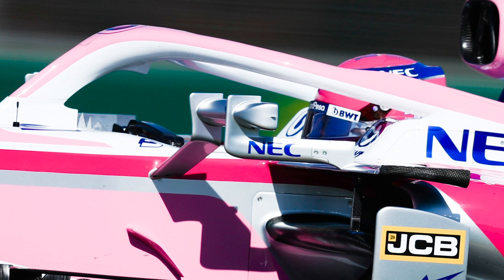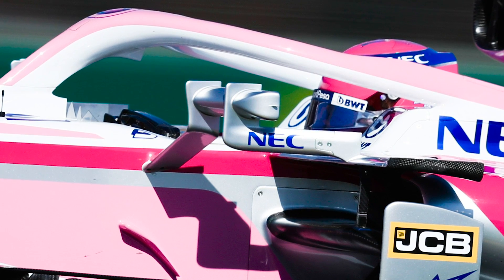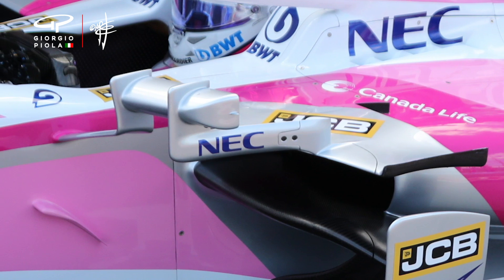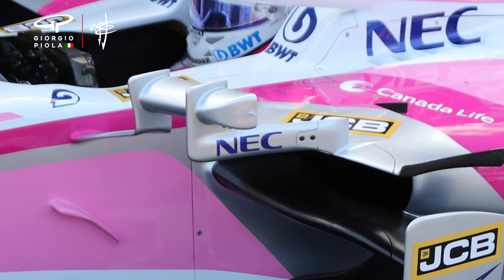They're collecting it up and cleaning it up with this one, then being able to clean up the underside of this one, then sending it on its way down the side of the car. There have been a few changes to the bargeboard. The mirror is also very different — it was a very conventional twin-mounted mirror before, but now they've come up with these very elaborate mountings. It looks like another little wing has been added. You can see almost vortex generators on the top side as well, and a flow conditioner here, just directing flow over towards the side pod, letting it drop down and carrying it around the floor. We're seeing a lot of mirrors being used as aerodynamic devices now.